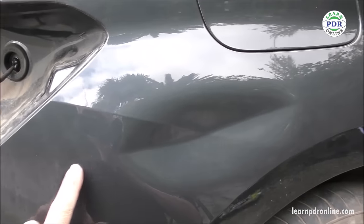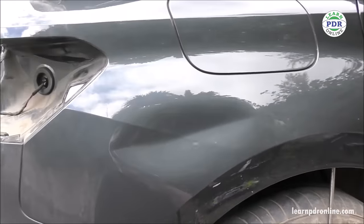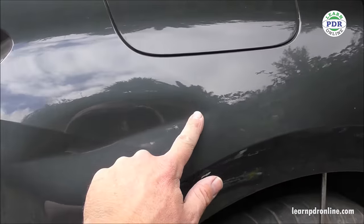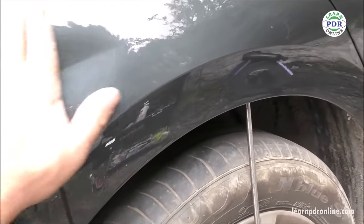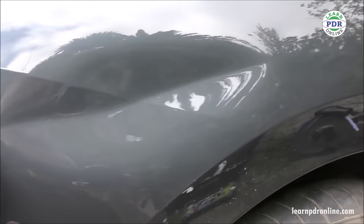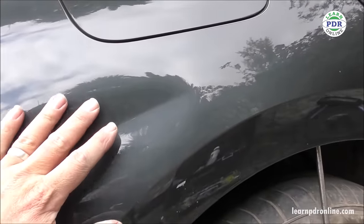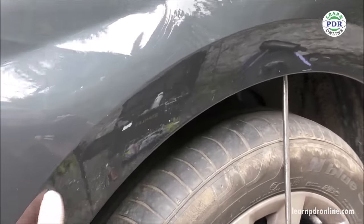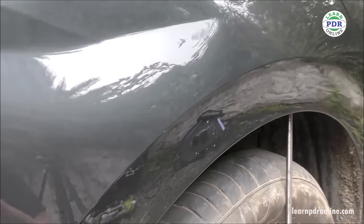So I've taken out the damage here and here, and now I'm going to be focusing on the main dent. We've got this crease that runs right through the dent - it's fairly deep, but it is fairly soft I think. I don't consider this a crown - that's just the top of the dent. It will start to release as I bring this dent outwards. There may be a tiny bit of tension on the body line of the arch, but nothing to worry about at this stage.